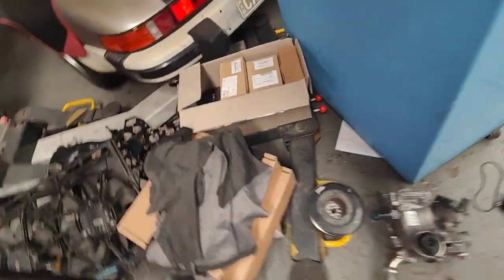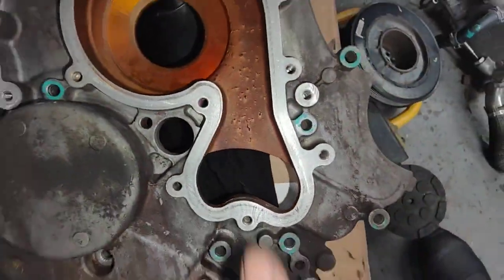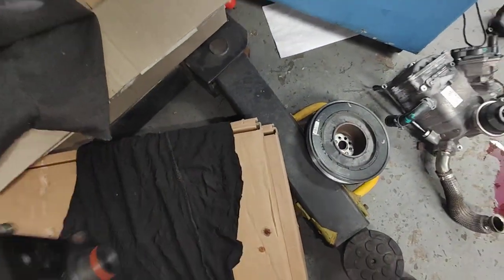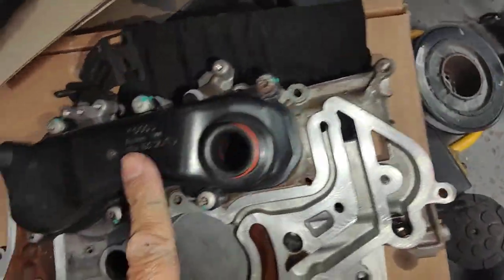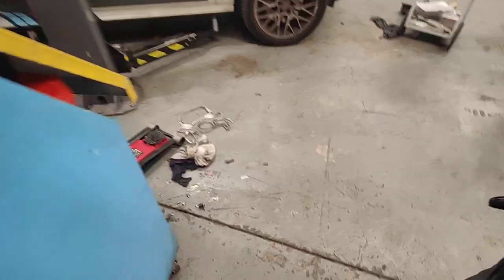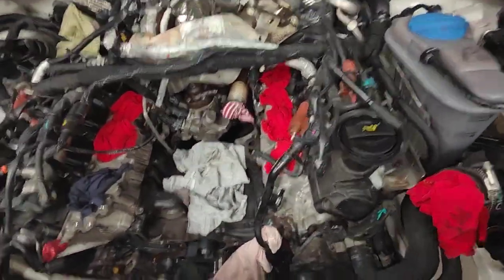So that's that job. Let me show you the actual cover — we just finished cleaning it up. This is the cover, nice and clean outside here where the water pump goes, and nice and clean here where the oil cooler and oil filter housing goes. This is the other side — brand new, nice and clean as well, as you can see. We have this new plastic flange here, a very new one, with a new O-ring, fitted with new gaskets underneath. We're now pretty much trying our best to get the bottom one done so we can fit the front housing and new seals.